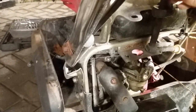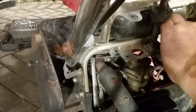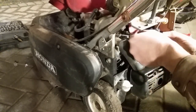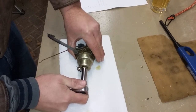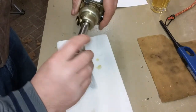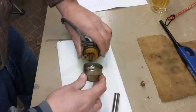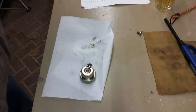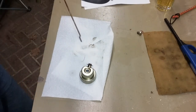Time to take off the carburetor and take a closer look. Fortunately this machine has a fuel shut-off valve - on a lawnmower you'd have to clamp off the fuel line, but here I can just shut the fuel off. I got the carburetor on the bench now and I'm pulling off the fuel bowl. I was also blowing into the fuel line and pushing up on the float valve just to be sure the needle was seating fully and stopping fuel flow, and it seemed to be working correctly.